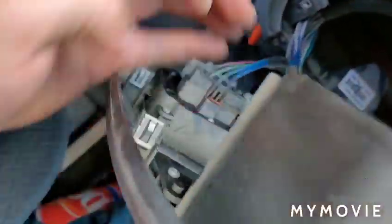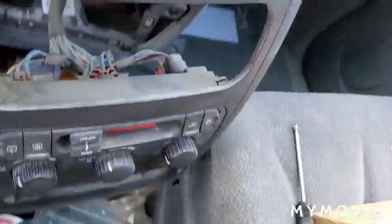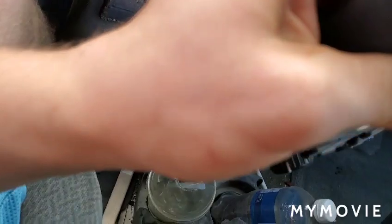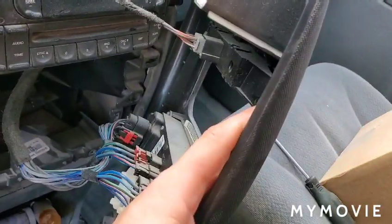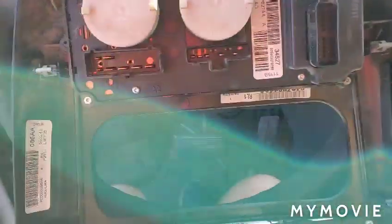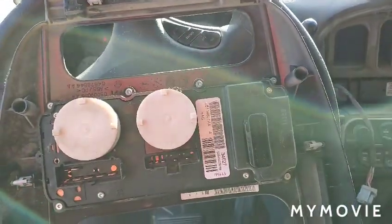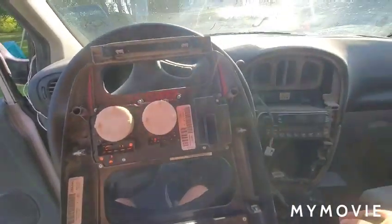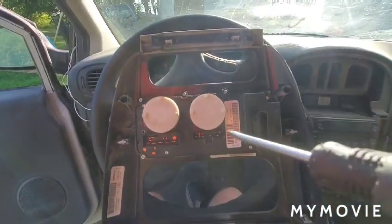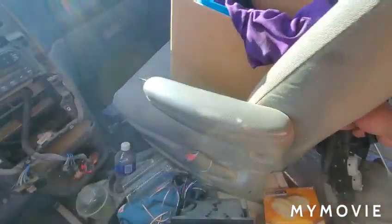Now moving to the back, we can see wiring harnesses. That one would be for the temperature control, and then there's one up here, which I guess is for this, because the stereo is still there. So I'm just going to take a flathead and disconnect these and then come back. Alright, I just disconnected the three harnesses, one, two, and three. All three of them I just pinched and then was able to pull, so it was actually very easy. I just zoomed out a little bit so you can see more. There aren't any crucial details that need to be zoomed in for this. Anyway, I can just take that and throw it away. Well, I'll actually just put it aside for now.